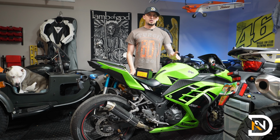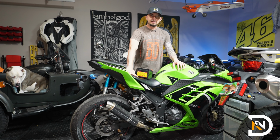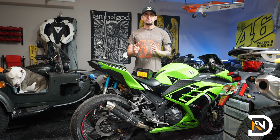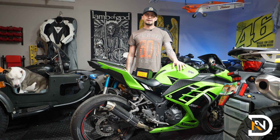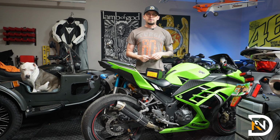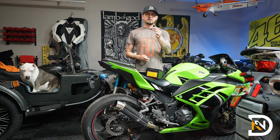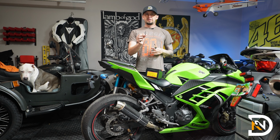On this motorcycle, just like most other bikes, the battery is located under the seat, so we'll need to remove the seat, pull out the old battery, pop the new one back in, and then leave it on charge overnight to make sure it's good to go the next day. This job's about a 1 out of 5 for difficulty. Should take you a half hour or less to finish. All you'll need is a Phillips blade screwdriver, a 4mm hex bit, and a 10mm socket.